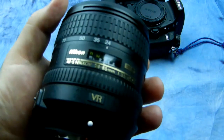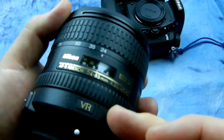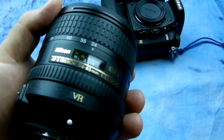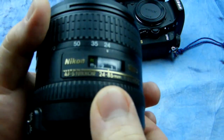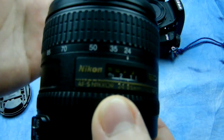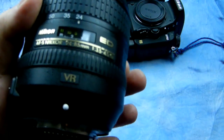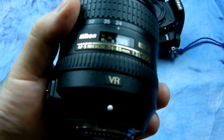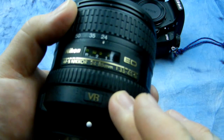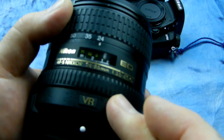When you put the lens on your camera, a common issue is that the internal gears driving the autofocus are slipping — meaning they're broken. Some of the actual gear spokes are broken off. Check for a grinding or buzzing sound when the lens tries to autofocus. If you hear that, return the lens or do not buy it. This is a common issue due to mistreatment — someone has used the lens wrong, dropped it, or the AFS internal drive has gone bad.